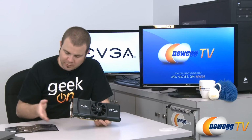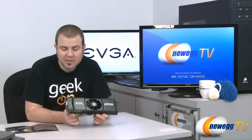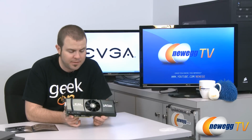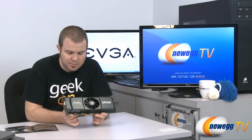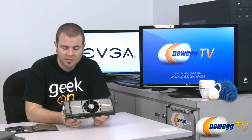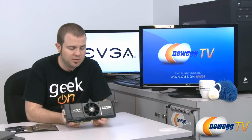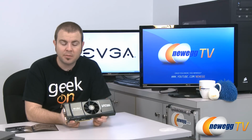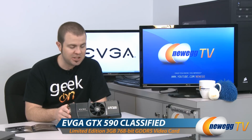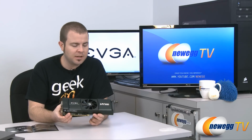Alright guys, and the last bit of information here is that you want a minimum 700 watt power supply to run the GTX 590, and that is a single 12 volt rail design with 50 amps on the 12 volt rail. So make sure that you have at least that. I would recommend even a little bit more because it's nice to have some headroom, especially if you're running a power hungry video card such as a dual GPU GTX 590. And that pretty much wraps it up for our first look and unboxing of the EVGA Classified Edition GeForce GTX 590 from NVIDIA and EVGA.